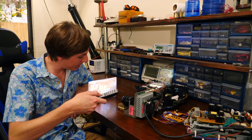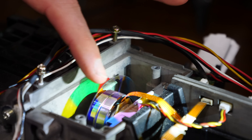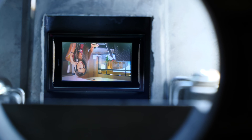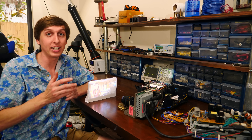If you look at this image right here, it looks like a completely normal image. But if you slow it down, it begins to flicker. That's because it isn't one single image, but rather a composite of five images, each corresponding to a color on the color wheel. So how this projector works is you have light shining through the color wheel, which has five separate colors on it. That light gets focused down onto a DLP chip, which has over a million mirrors that can either reflect the light towards the screen or bounce the light away. When you're watching a video on the projector, it's processing each frame and dividing it into five separate frames, one for each color, then playing them back really fast so it appears like a normal image.